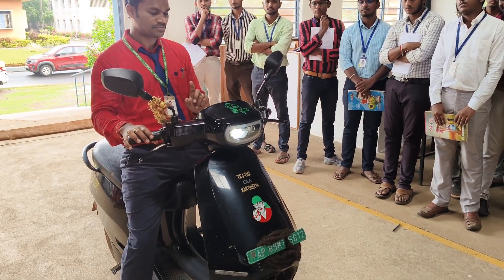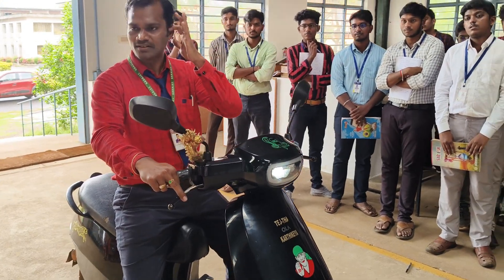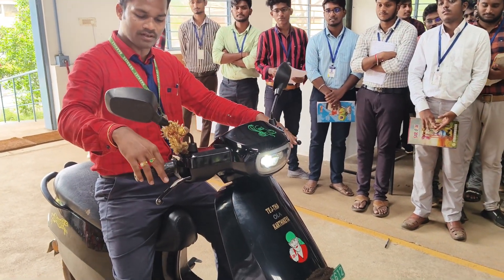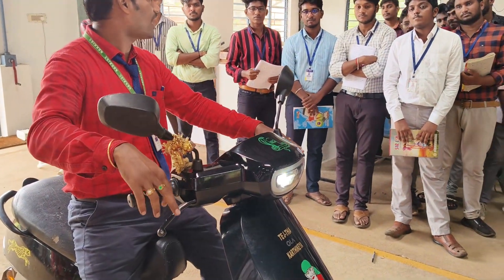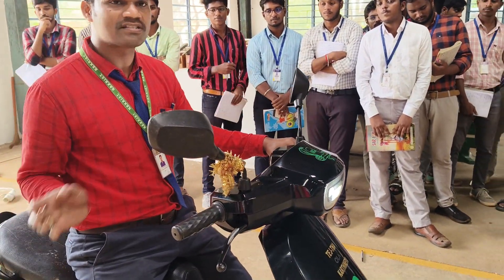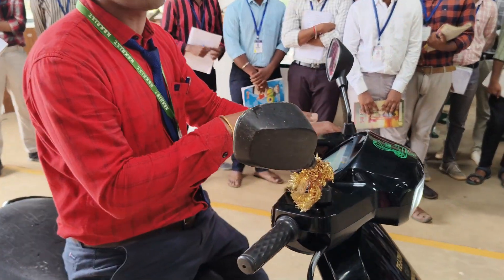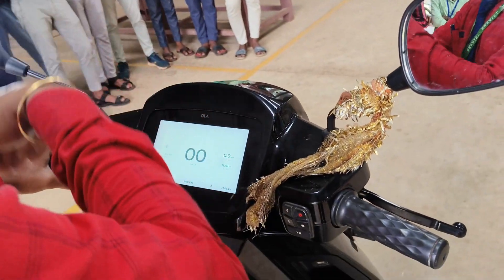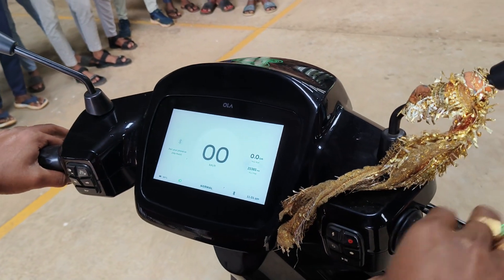Let's try to enable reverse mode. You see these two modes of operation — I will show it. First, I will apply the acceleration and later reduce the acceleration — you can see the change in color. If I apply the acceleration it will show red color, meaning battery power is consumed and it is operating in motoring mode. When I reduce the acceleration, it will come to forward regenerative braking mode.